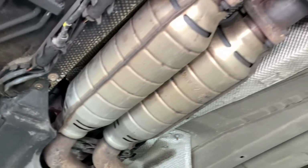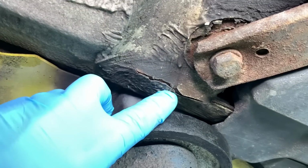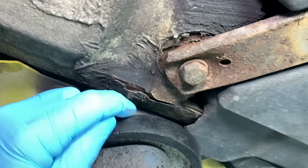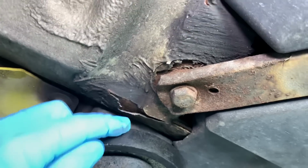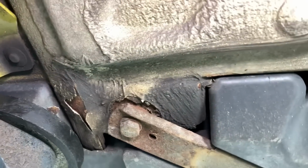So we're just going to be going through the car. First of all, strip down, do a fresh assessment, check out the corrosion, see if it's changed much in the last 10 months since the car came in. We know we're definitely going into the jacking points and things like that, because having all these cracks in the seam sealer is no good. It's showing that corrosion is in between the metal layers, growing and forcing the seam sealer open until it can't be stable anymore, and then it just breaks, which obviously amplifies the situation, because if it's not protected from the elements, then water and salt get in and it just carries on exploding even more, especially around the V-brace mounting boxes as well.